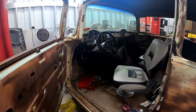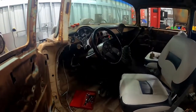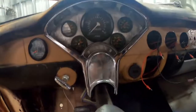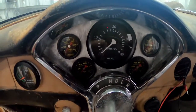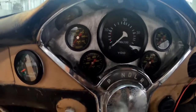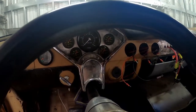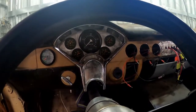I've got a few things to update you on since the last video. I know it's been a few weeks — progress has been really slow but steady. Anyway, here's the gauge that I'm running. Like I said, it's a VDO 4000 RPM alternator-specific marine application tachometer, and it's got three posts on the back: one for 12 volts, one for ground, and one for the signal, and like I said, the dip switches. Let me show you where I source the signal from.